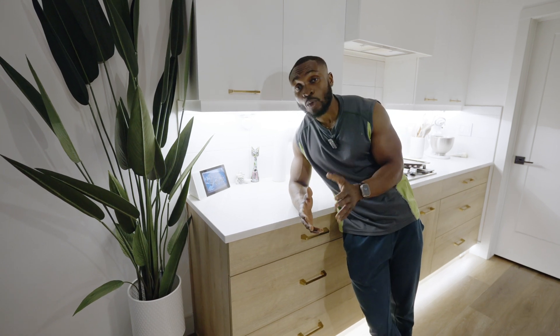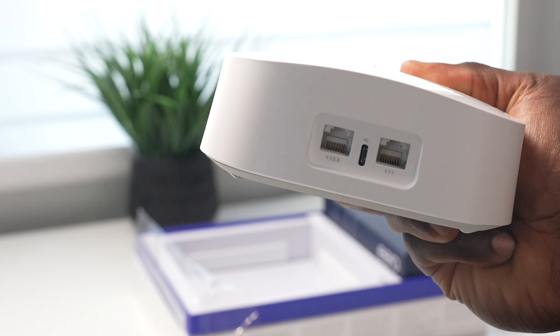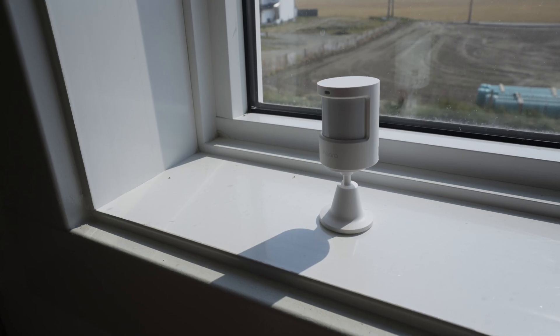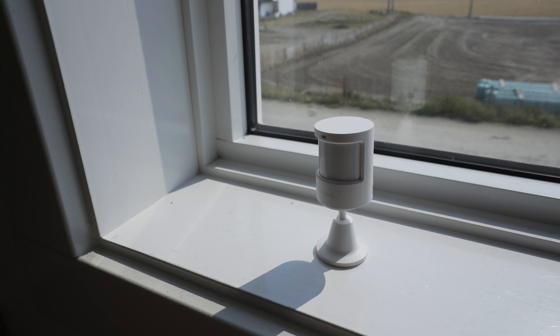The Amazon Eero has a 2.5G wired internet port capable of speeds up to 2.3 Gbps — impressive numbers most households can make do with. It is built for a smart home: it comes with a Thread radio as well as a Zigbee radio. This helps connect devices like Aqara's P2 or contact sensors without needing an additional hub. The vast majority of smart home devices currently use Thread, Zigbee, Z-Wave, or Wi-Fi, so the Eero covers three out of four. You do need the Alexa platform to access the Zigbee radio, but for Thread it just acts as a Thread border router, so any Thread device connects to the internet through it.